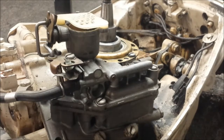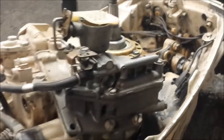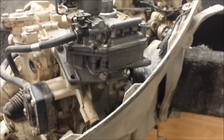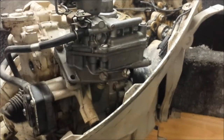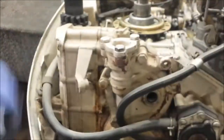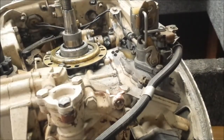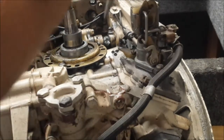Put it back on — same thing to get it off. So I've already got one screw out. We got one here, here, and two in the back. You can see the one in the back. The ones in the front are pretty self-explanatory to get this carburetor off. But this one right there, you're not getting off with the flywheel on. But we're almost removed here.